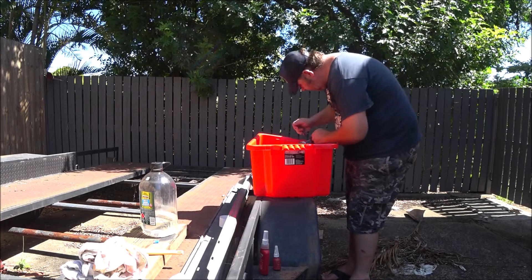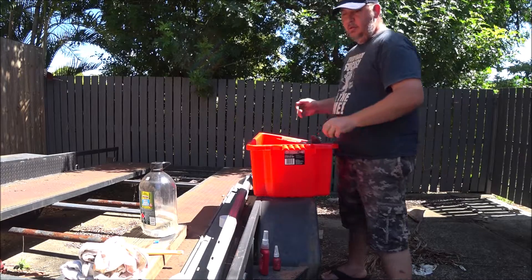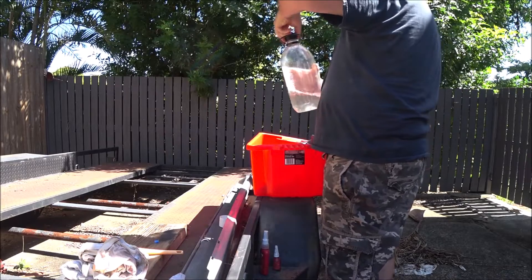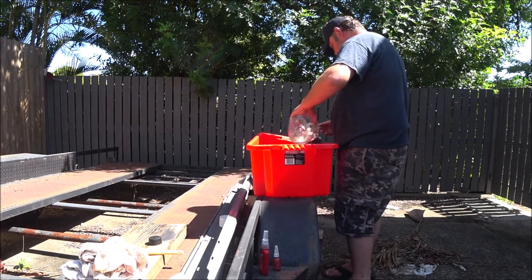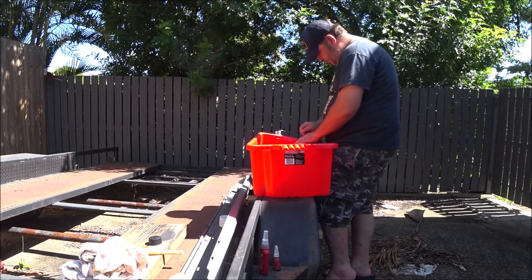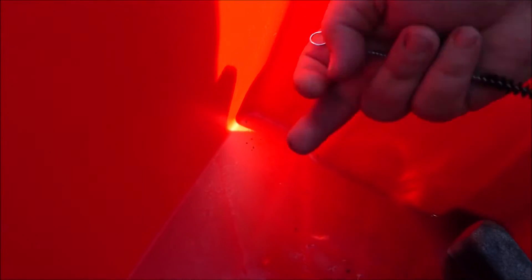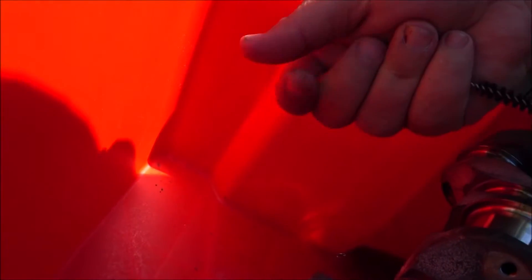The pipe brush running through the journal, through the oil passages. Brake cleaner tends to dissolve it immediately, so some solvent down the hole. You can already see grit like this has come out of it — all of this was trapped inside the crankshaft, inside the journals. That's why you do this step.